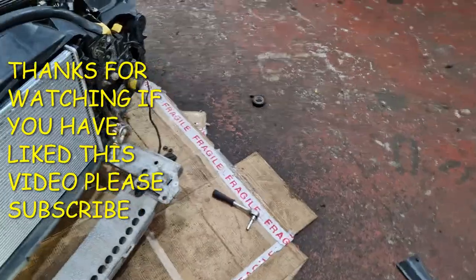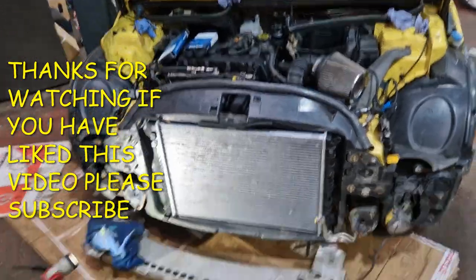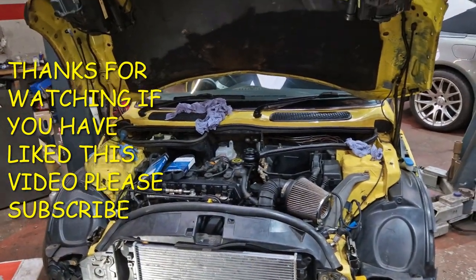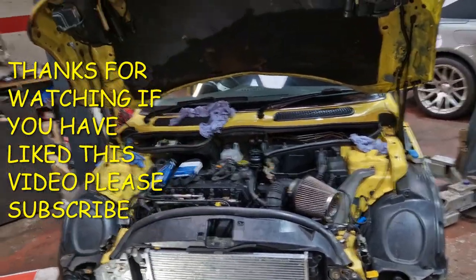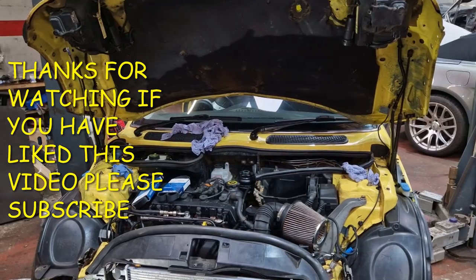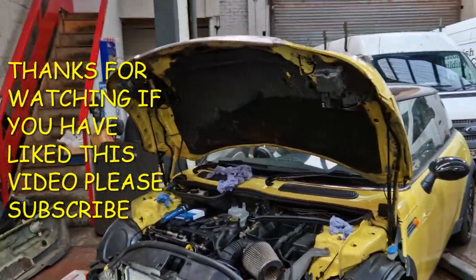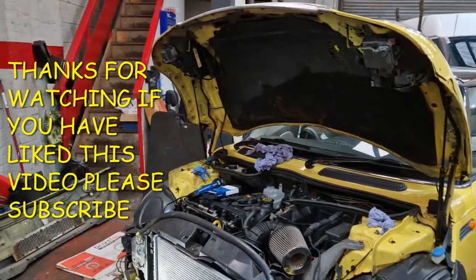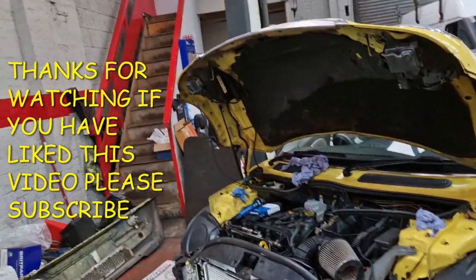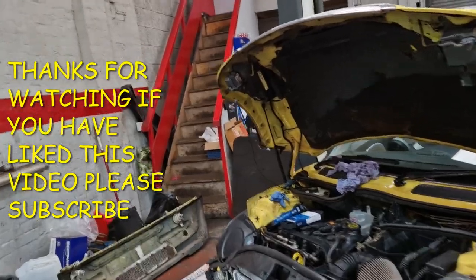It's not too bad — the aircon condenser has no gas in it so I'll leave that off, but probably best if you want the air conditioning working, just get the full thing re-commissioned. The car's probably going to want a blower motor as well — it seems to work and then stop working. We need to get some petrol in the wee car too as it's really low. But the fan is now confirmed working, so hopefully when it comes up to temp it just kicks on and off. The wee car's getting a fair old restoration.